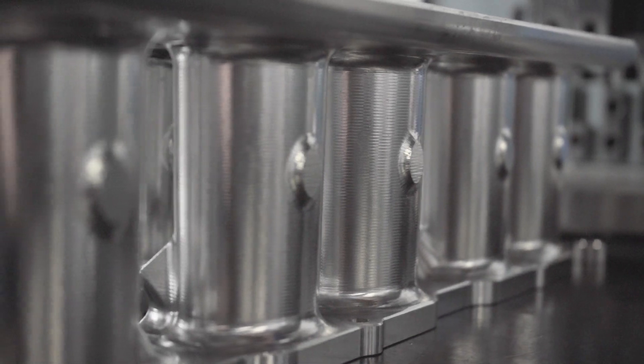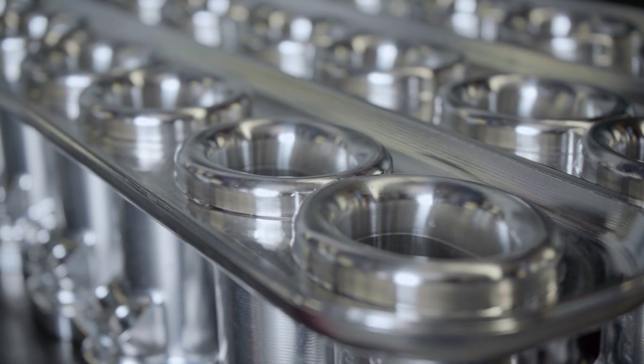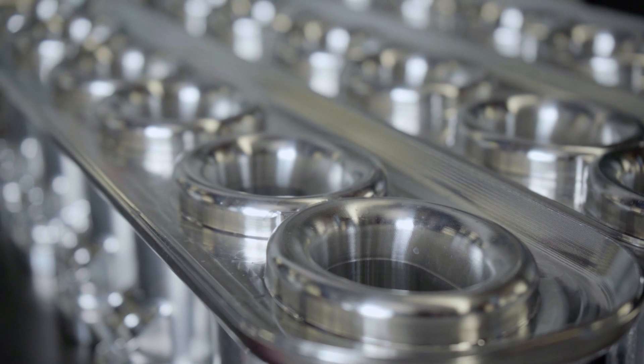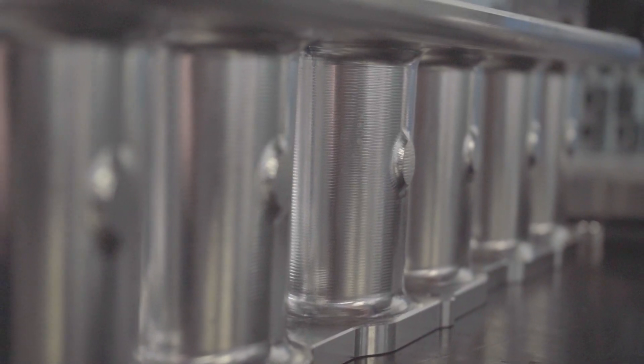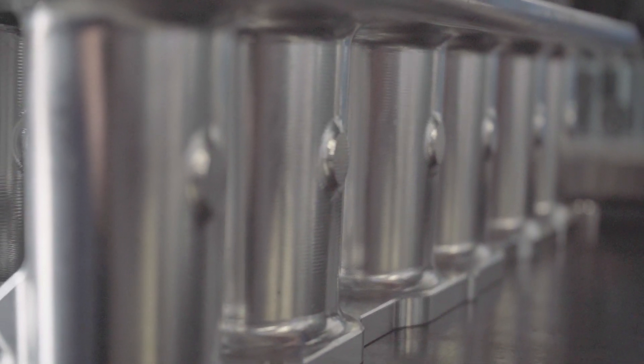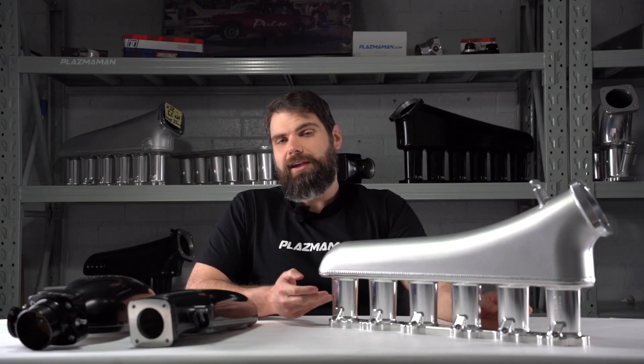The intake manifold has a whole new set of runners, and there are a couple of reasons as to why you'd want to do that. This brings us to the first basic of intake manifold design: runner length and volume. There's a lot involved in runner design theory, but the basics are pretty simple. Shorter runners in your intake manifold will help the engine to produce more power up high, and in some cases can actually allow the engine to rev even higher than it normally would — but you may sacrifice some power down low. And this is why we have the option of intake plenums for some engines.